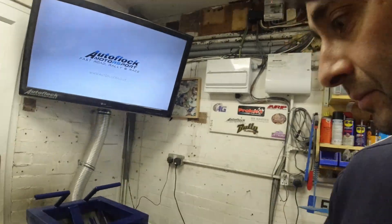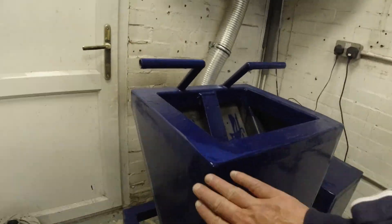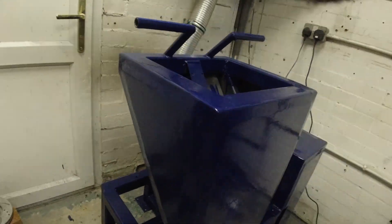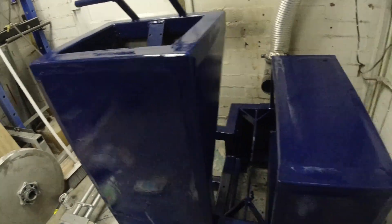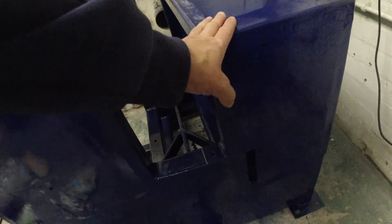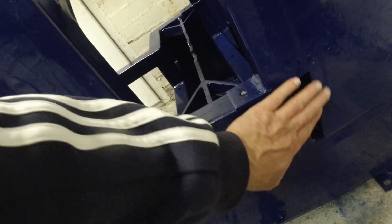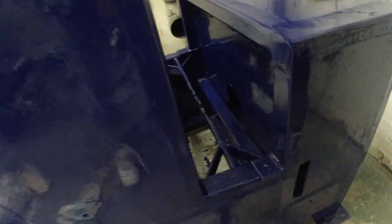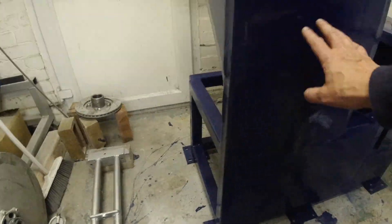Let's have a look at what I've done. I've managed to finally get some paint on, finished all the welding, and smoothed in all the welds. I think it looks a lot neater than it was - it's not bare metal anymore. This is the removable panel. I'm going to get some sort of brush seal that goes on the edge here just to seal this gap but still allow it to close nicely. It's nowhere near lined up yet. I've used an engine enamel paint and brushed it on - there are a few runs in it.